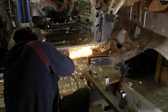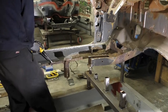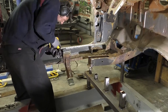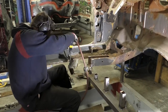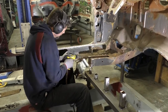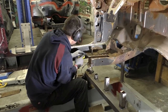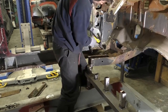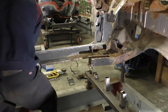I'm cutting the rocker panels out in smaller sections — they're a little bit thicker metal, so it's easier to section them out, bend a little, and with the air chisel just work my way down and keep pushing them off little bits at a time. I've done rocker panels coming in through the bottom with the air chisel and it takes forever. To me it's easier to cut down the middle, not hurt any of the brackets or pinch welds, and then air chisel them right out. The next step is to add jig supports to these rocker panels. I didn't cut the front bracket off the frame rail going to the inner rockers yet. We're going to jig this point up, make sure the rockers don't move, add our brackets, then come back and finish the removal of these rocker panels.